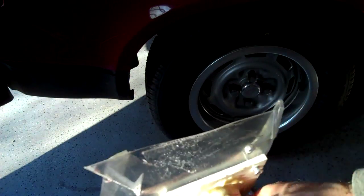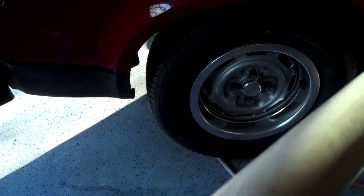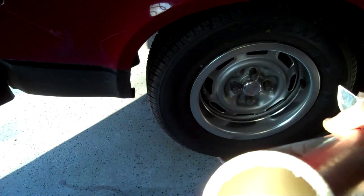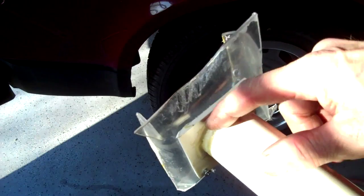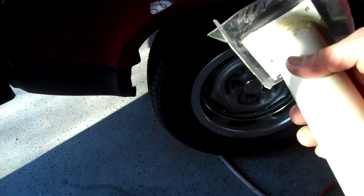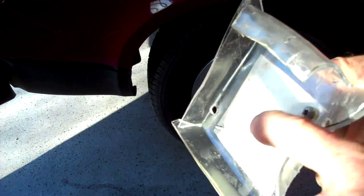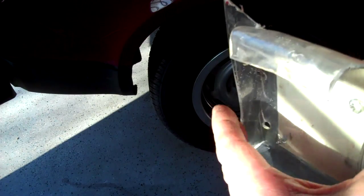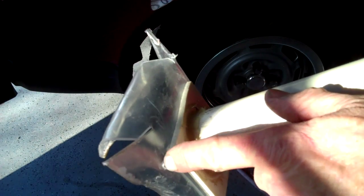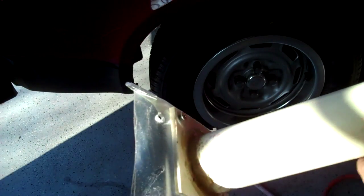Here's what I did. This is the piston, which is just PVC pipe — it's one and a half inch internal diameter — and then you have to glue some sort of cap on the end of it to make it airtight. This half-ass plexiglass thing is just a little four-sided box to keep it on the brake pedal. The top wall of the box has a hook on it so you can hang it on the brake pedal and keep it contained. There are also two little holes drilled to hook bungee cords in to help retract the piston back after you've deployed it.